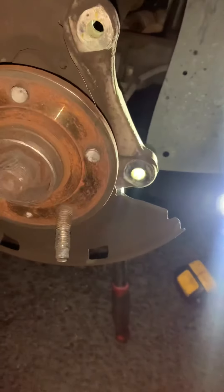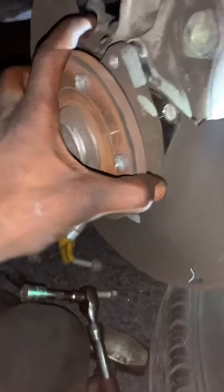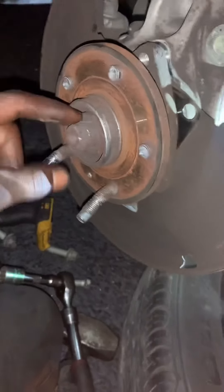You have to push this axle back and then pry the inside of the socket. So I got my three bolts out the back — one, two, three. For the top bolt, you're going to have to put an extension on there to get past that axle shaft. After you get those three out, you just want some lift.